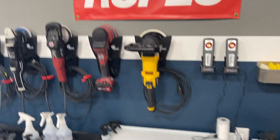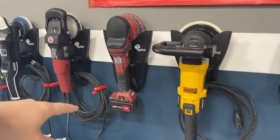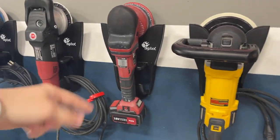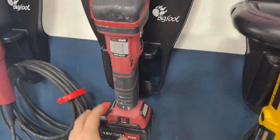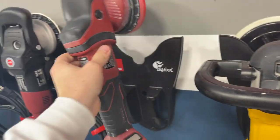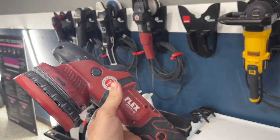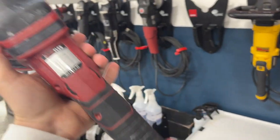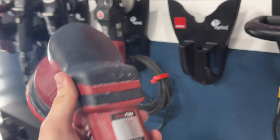The next machine is battery powered. You might say, well why would you ever want that — you're gonna have to charge the battery. Not really, because it comes with two batteries. They both have about 35-minute working time, so by the time one battery is dead the next is fully charged. It's kind of a never-ending process so you never run out of battery power. It's a great polishing machine; doesn't have the greatest correction ability, but it's a very handy machine we use every single day. It's the XCE8 polishing machine — it's a forced rotation polisher.